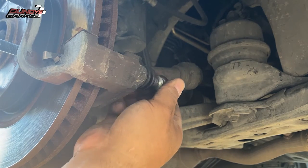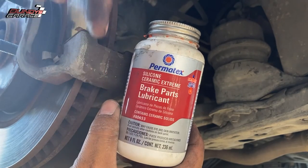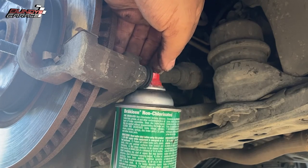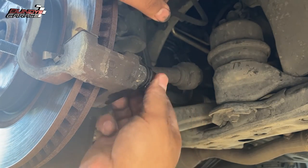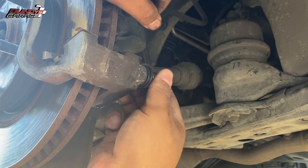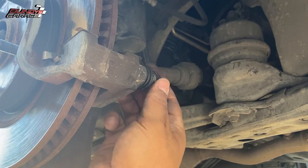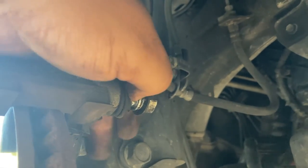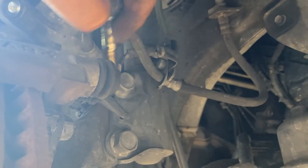Before you apply new grease, make sure the hole and pin are dry from the brake cleaner. Then apply new brake slide grease — I use Permatex silicone ceramic extreme brake parts lubricant. I'll put a link in the description below. I recommend the larger bottle if you're doing a lot of brake jobs, or a small one for a one or two job situation. Clean it all up, get the old grease out, apply the new Permatex grease, and make sure everything's working smooth. Always remove that piece of rubber at the end of the caliper slide pin — there's no reason for it. And don't give me the 'engineers always know best' argument — if engineers always know what they're doing, why was the Ford 6.0 diesel engine such a piece of junk?